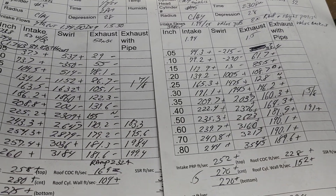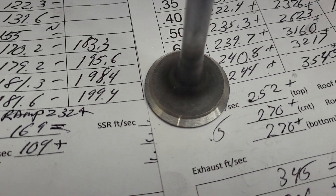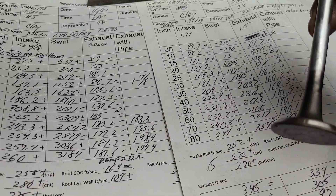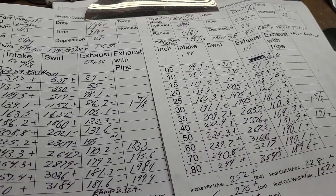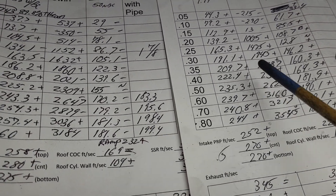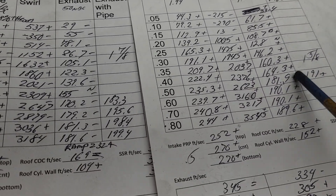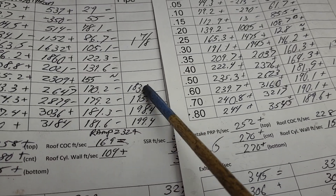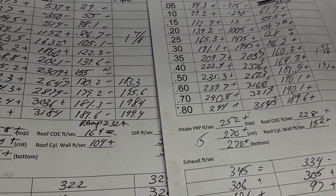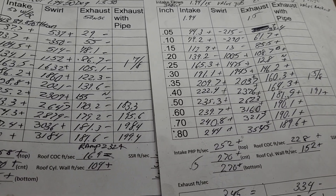Let's take a look at our exhaust with a 50. That's a 50 — no back cut. You can still see a bit of the old 45 all the way up top. I didn't want to shrink the valve down too much — it's a completely stock valve. All losers, all the way down. I used an inch and seven-eighths pipe here and it's still less. Took a beating with the deeper valve job.